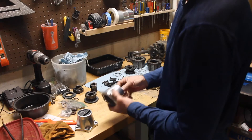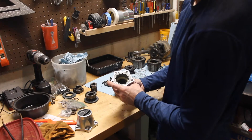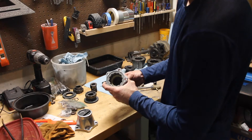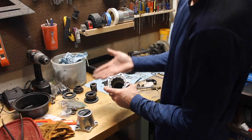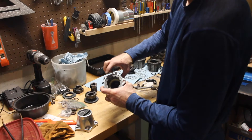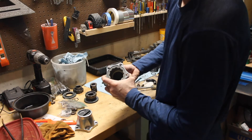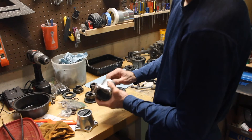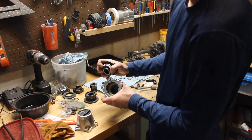When you've got your hub put together, you can move your locking switch arm into 4-wheel drive or 2-wheel drive. When you do that, you'll notice that the inner plastic ring slides up and down because the threaded plastic washer uses the spring to compress or release. You can see how it goes from 2-wheel drive — the spring presses the gear further out into the housing — and then when you move it into 4-wheel drive, it expands and engages the gear. And then you're in 4-wheel drive.